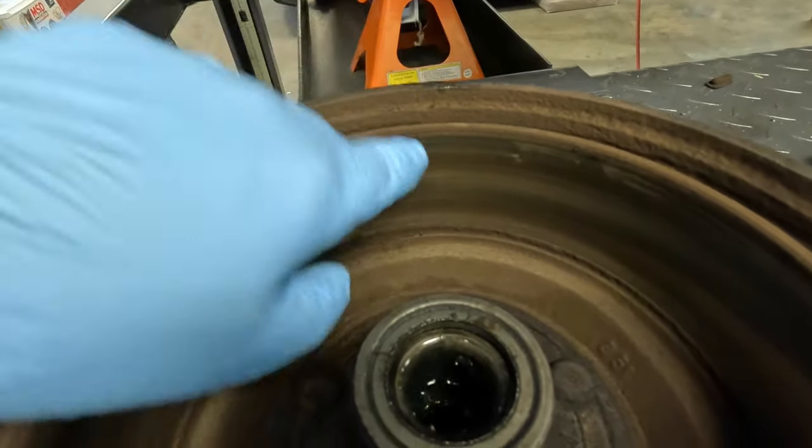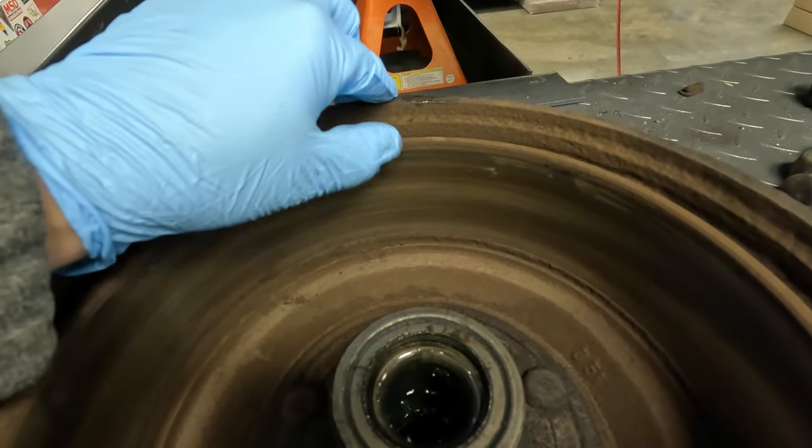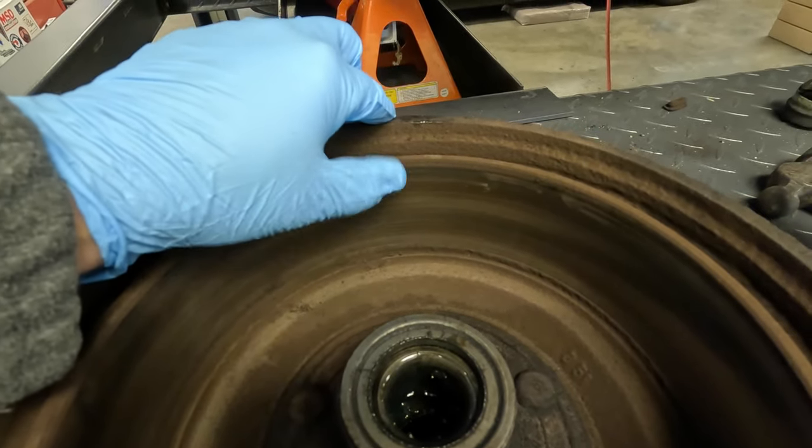Let me get this bearing out of here so I don't drop it in the muck — try and keep it somewhat clean. Voila! So this is that adjuster, and you can see it hits on this piece right here, preventing it from going backwards. In order to get this to loosen up from the backside, I actually have to come through this hole, push this away far enough to be able to turn this with the special brake tools for drum brakes. Here's where that lip will build up and keep the drum from sliding off easy.